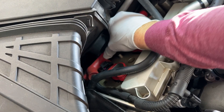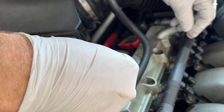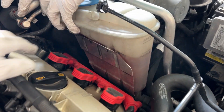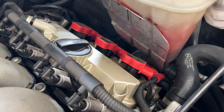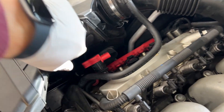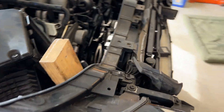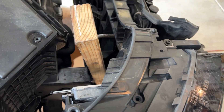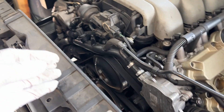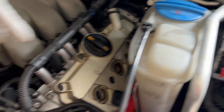We're moving this harness out of the way and pulling out the spark plugs. This has to be moved aside a little bit — it's impossible to pull them out otherwise. Once that's done, we put it into service position. I'll link to the video for that; there are a couple of good guides. I like to remove this piece here — just disconnect this end, it goes back in easily — and you'll just have the clamp here to deal with.